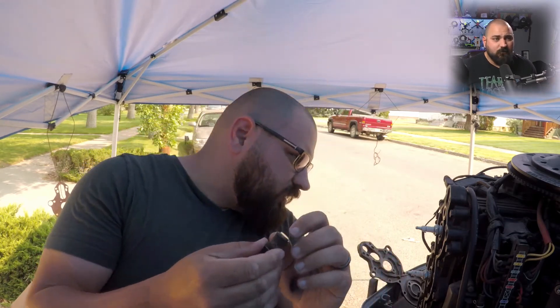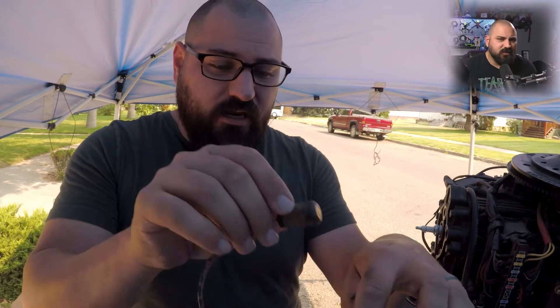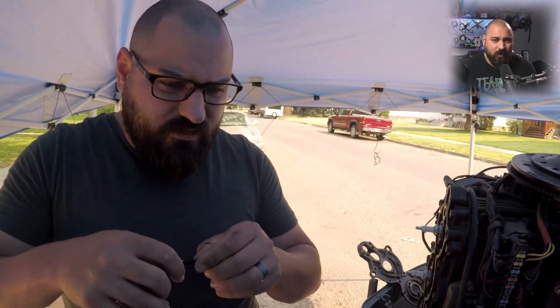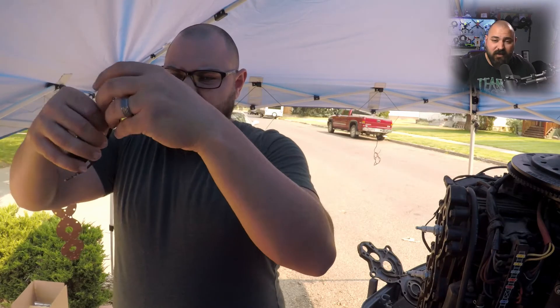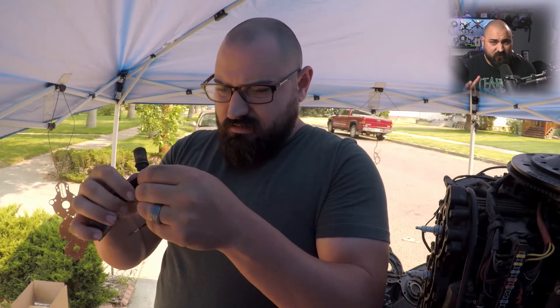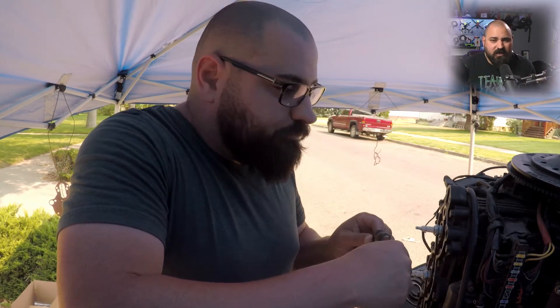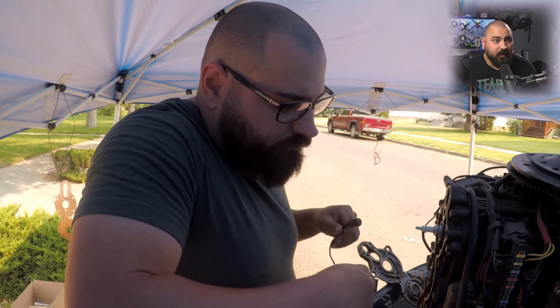Because of that, I decided I was going to go ahead and just tape it up as best I could and reinsert it back into the back of the motor where it would be sensing heat. Not sure exactly how it works — it's called a heat trigger on Boats.net, and of course it's not an available part. It's not sold anywhere except on eBay, and when I looked on eBay specifically for this part, I cannot find the exact part. So I had to make do — tried to clean it up, get all the rust off, clean out the area where it inserts, and just put it back in. There's one on each side, did the same for both, and there's a blade connector where you connect it back up.